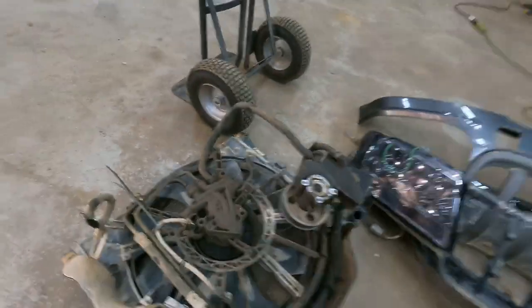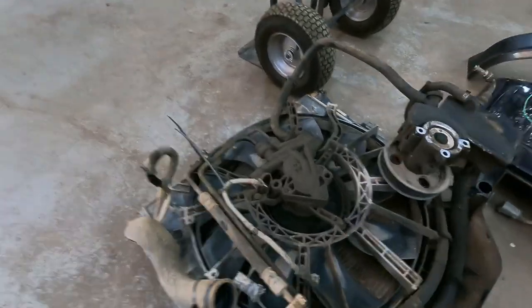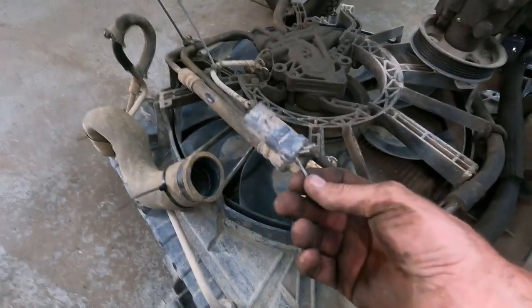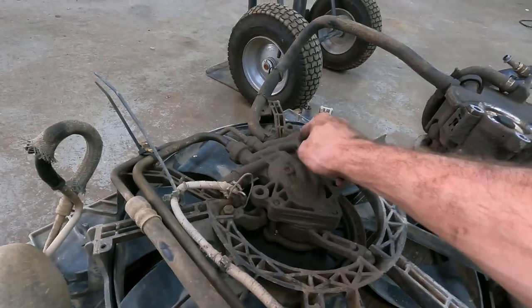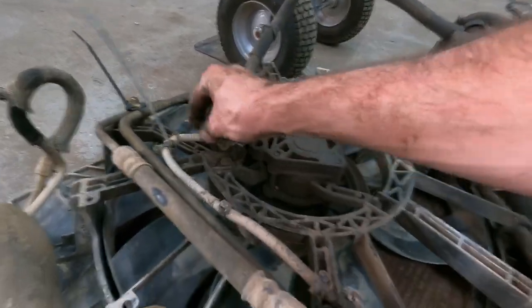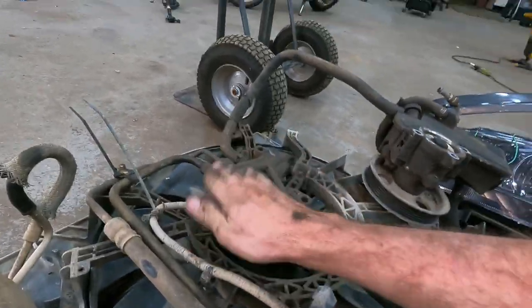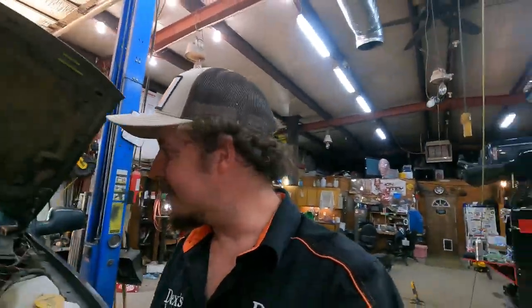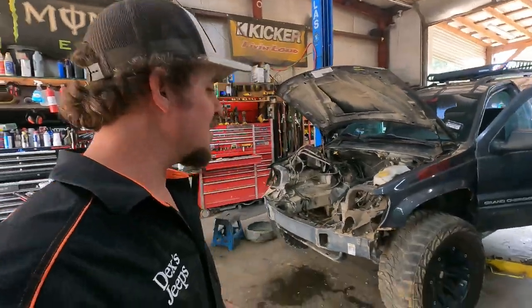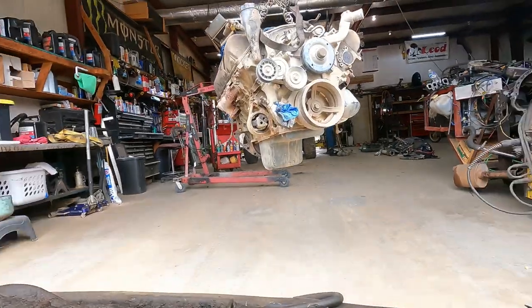It's got a hydraulic fan. The power steering pump puts out more fluid — we'll do a video on that one day. Somebody cut the wires that control like a purge solenoid that controls how much fluid goes through there. I think they had it on a flip switch thinking it was an electric fan. It's a pretty good idea but you should have just stuck with factory stuff — it doesn't go bad. The springs were just dangling, so we kind of lowered her down to get the motor out, but I'll put them back in and move it around.